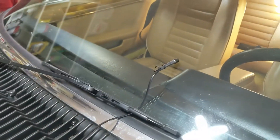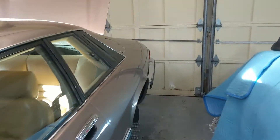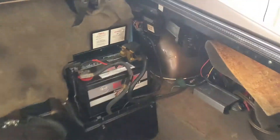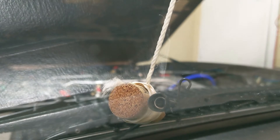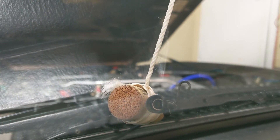There it is with the cable running up. I'm just going to depress the throttle — I'm mostly not going to start it because I'm in the garage and don't want to open the garage door as I've warmed it up. Let's give it some power — the battery's good. So there's the noid light. Ignition is on, press nothing — you can see the capstan turning — but I am not getting any noid light activity. It doesn't seem to be doing a thing.